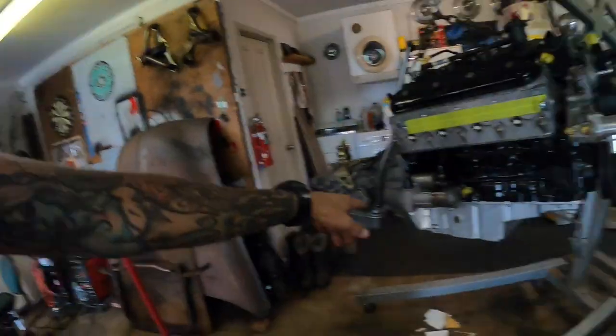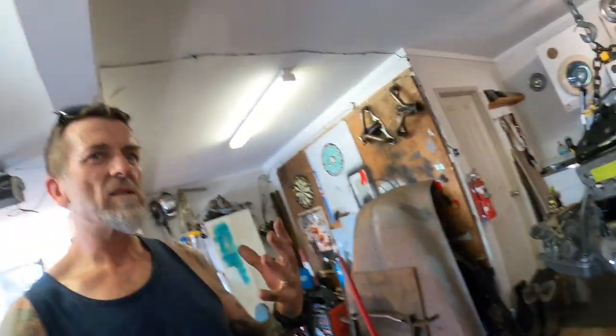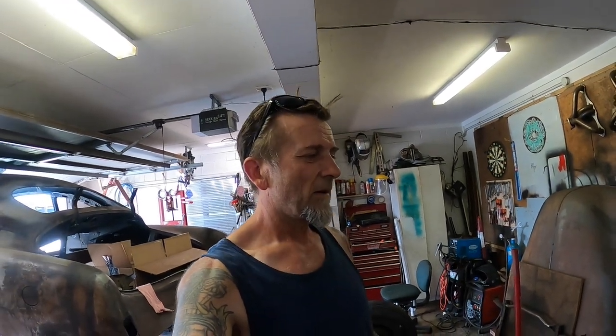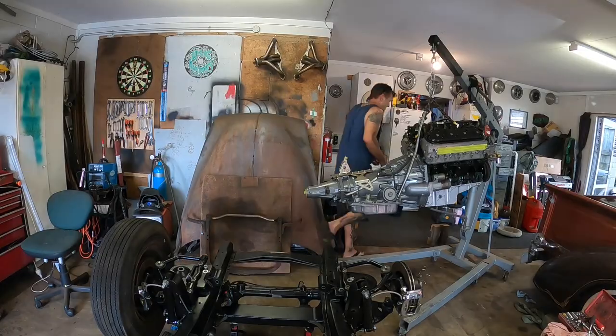So these starter motor bolts I got from Rock Auto, so they're just generic Dorman or something like that, so the heads on them were just a little bit too big and they were kind of rubbing against the bell housing, not so bad without that extra bit of alloy in there, but bad enough when that was in there to be throwing it all out. So now I'm just going to take them all back off again, clean up some mess, chuck some paint on them. I'll just do that silvery stuff. Okay.